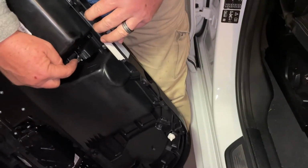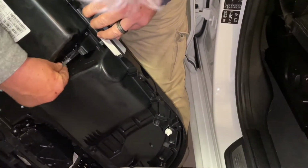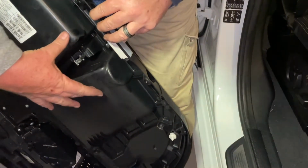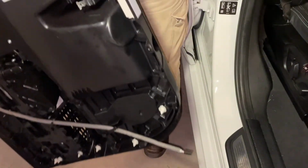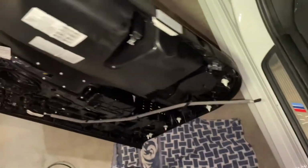I'm going to need the film. You see that shines onto there, and then it uses optics to send that light through into the door pocket here. We'll clip that back in place. That is it. The door panel is now off. Gosh, that was a lot of mucking around with electrical plugs to get it off.